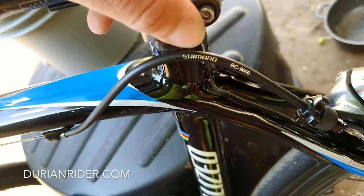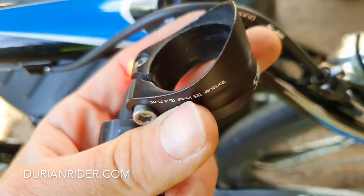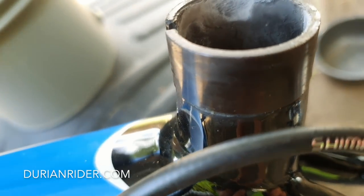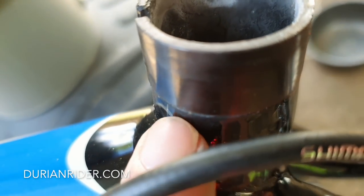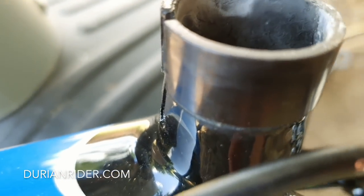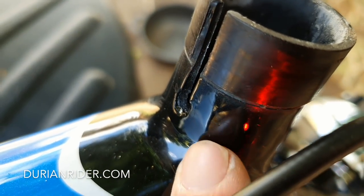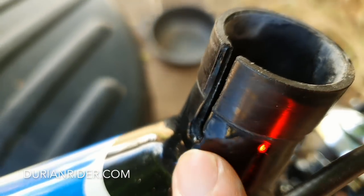We can pull off the seat cap and check that for any cracks. It looks pretty good. Around here there's an area that's prone to cracking — that's just a little lacquer mark, looks all hunky-dory. Occasionally if someone does a seat post up too tight it can split, it can crack just there. It generally cracks but doesn't go any further than that, so no reason for concern. This one looks legit, can't see any damage.